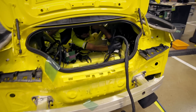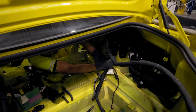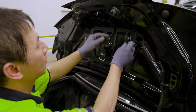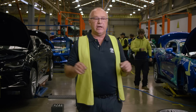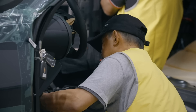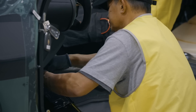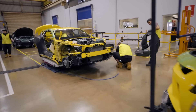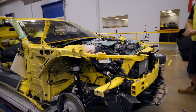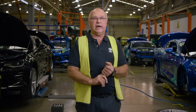At Station 2 we start loading the new harness back into the car and then we start reattaching all the boot compartment, fuse box, amplifier and start relaying all of the harness in the boot area. Once we've relayed the harness into the boot area we start fitting all the boot trim back into the car. There's another operator that works at the cabin of the car — it's his role to start affixing the new harness back into the car into its original positions but flipped. He'll start putting the rear seats, the rear trims, the roof lining back into the car.